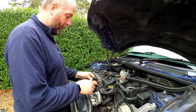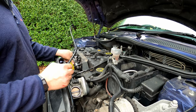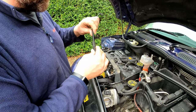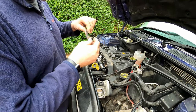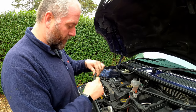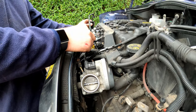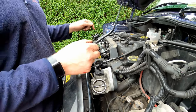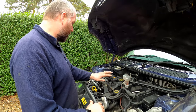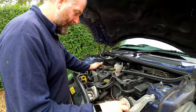Connect the electrical connector for the throttle body. There's a little hose that needs a new clip — it looks a little bit perished with some cracks on the outside, so I'll see if I've got another piece to replace it. I'm definitely going to get a new clip because the old one is horrible and rusty. That clip connects here onto this tube and goes over to the top of the purge valve — the fuel tank vent valve. We'll look at doing that when we put the vent valve back on. Next up is the air box.